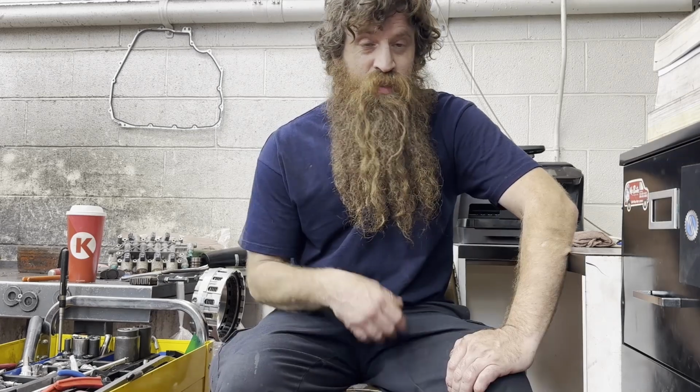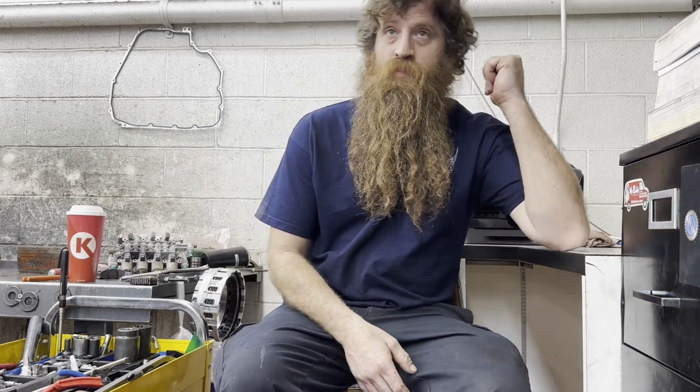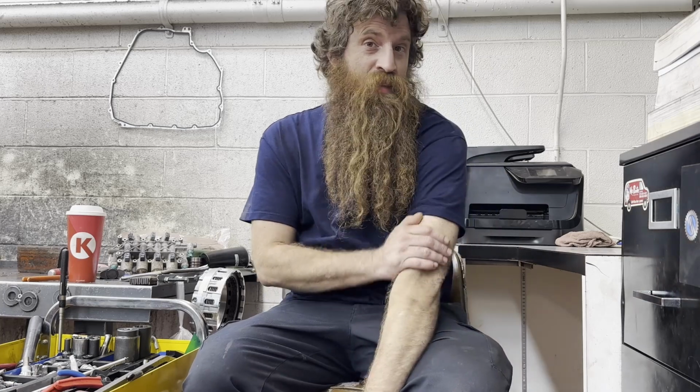Torque converter bolts were the hard part. They're triple square 12. Pretty sure there's 6 of them. It's ridiculous. So, there might just be 4, but still. It's the hardest torque converter I've ever removed. Hopefully this video is helpful, give you some tips and tricks, and show you what it took me to get it out. It wasn't easy.